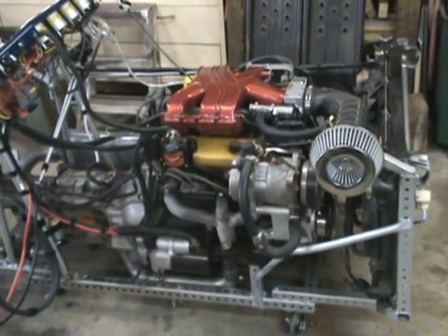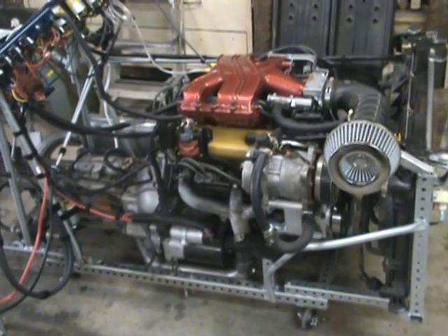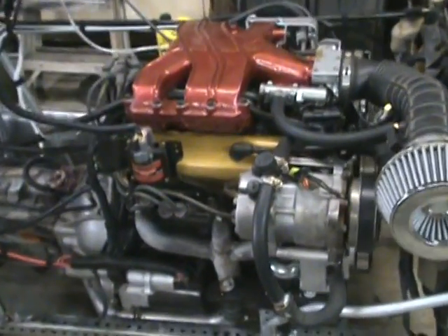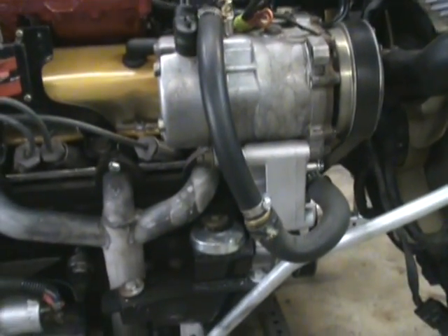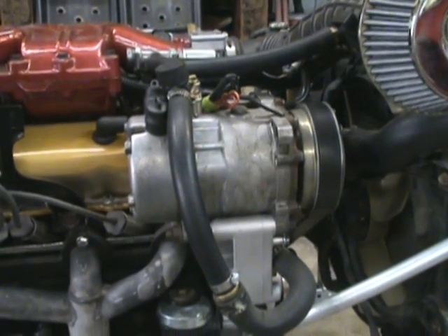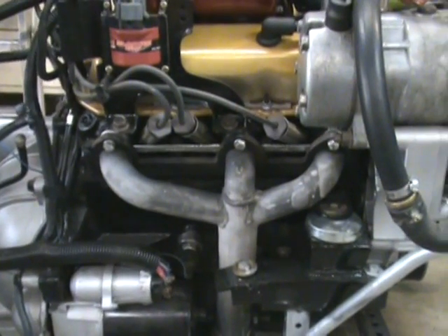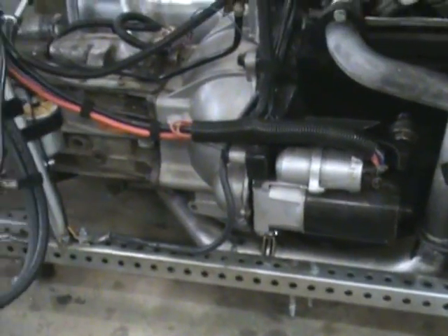It's out of a '92 Camaro, originally destined for my MGB GT, but who knows — maybe it'll go on my GT6. A few tidbits added in here: using a 3.1 liter alternator stand to mount a Sanden 508 just as a temporary AC compressor, so I have a belt setup.